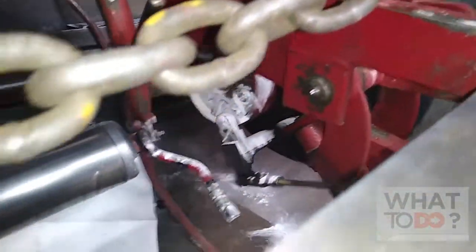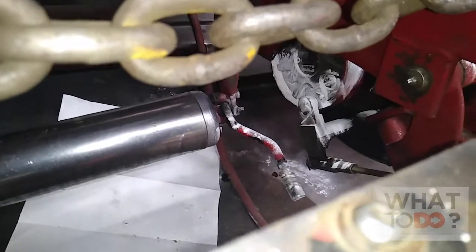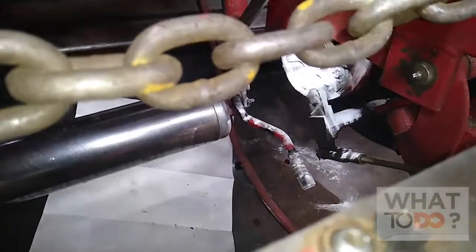The good old baby powder trick certainly helps you find those leaks. I thought it was coming from the other side too because of a big puddle, but it probably just dripped down onto the other roller and made its way down, creating a puddle — so it wasn't coming from that side either. Get some baby powder for your leaks and it'll help you track exactly where the leak is coming from. Hope this helped — hit subscribe, hit like, see you next time.